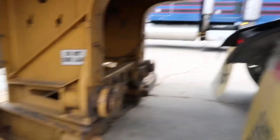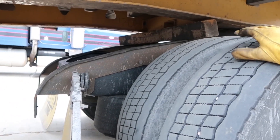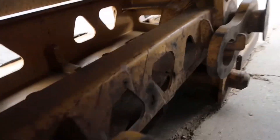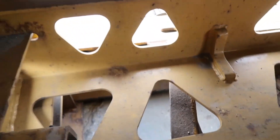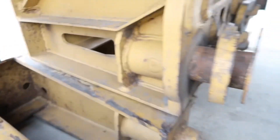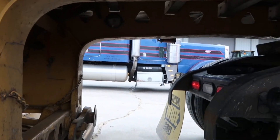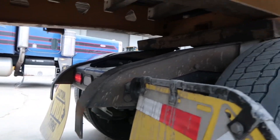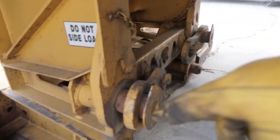So I'm gonna disconnect from the beginning — I got my board in there. I can take my board out because there ain't no pressure back on it, but you have to put that board in there to get that arch to release that pin in there. It's a pin that runs through there. Now I'm finna get that board out of there, release my king pin, and we finna get back up out of it, then hook our lines back up, and then we can go on the road. And we gotta put all that back too.